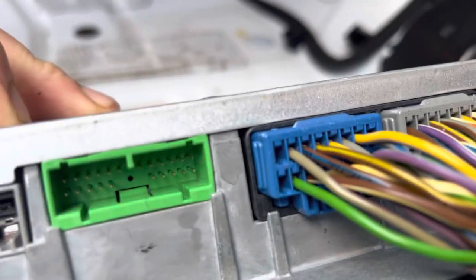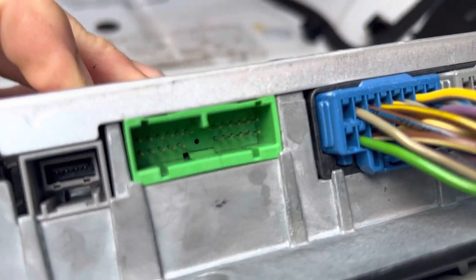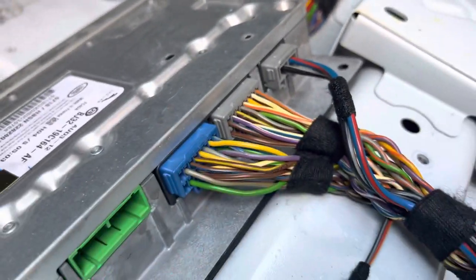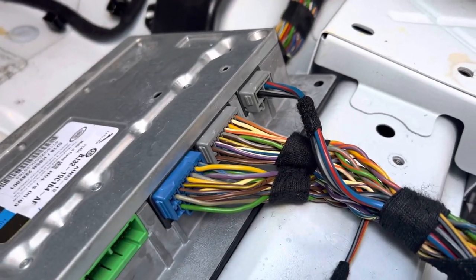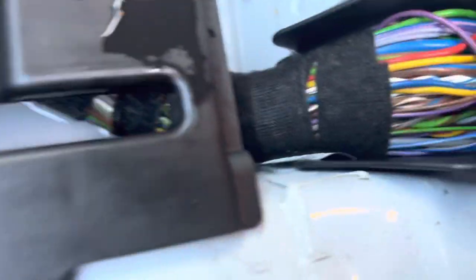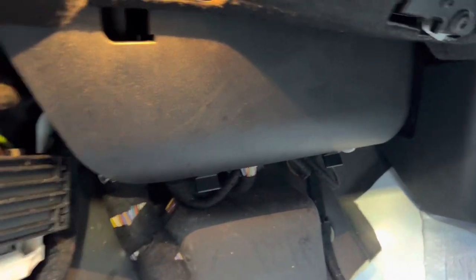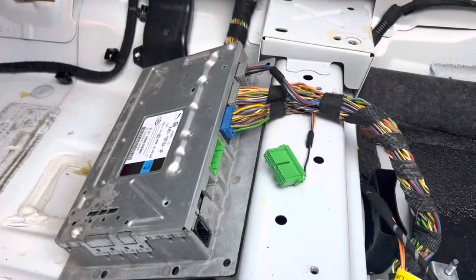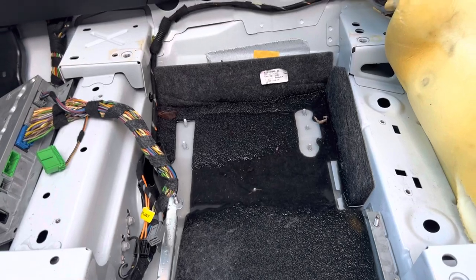Check all of the pins in the connector plug. If you've got any really badly corroded ones, you'll need to de-pin them out of the plug and replace them, which you can buy from Land Rover with little bits of wire attached - so it's not a major issue. Also check any other connectors on the loom where the water's been, and lastly check for the source of the water leak, which can vary. You always need to fix the source, otherwise when you replace the unit it'll just fill up again. So that's this one diagnosed - new amplifier and it'll be good as new. Thanks for watching, bye.